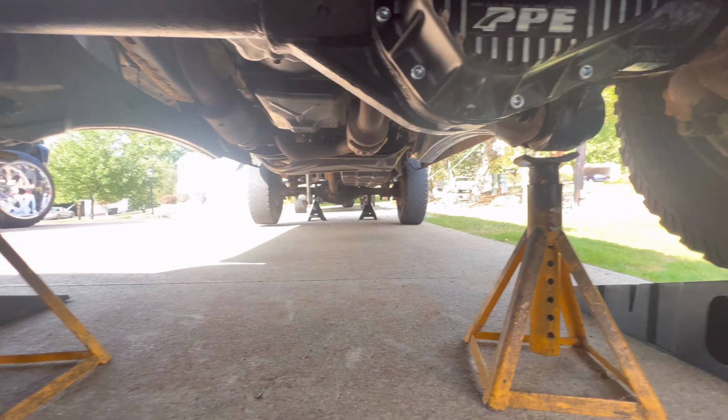And we are using the Motorcraft 80, 90 weight for the front, sorry for the bad angle. We're gonna slap that in there with the transfer pump. Same thing, make sure you run the old fluid out of that pump from the rear so it's not mixed. And yeah, we're gonna put her in. Front is done. Once it started almost coming out of that fill port right there, you're good to go.